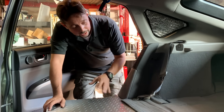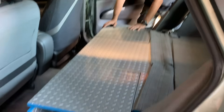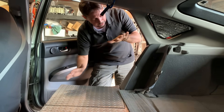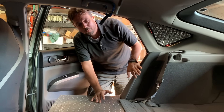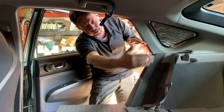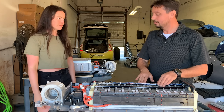So that little vent area in the back of your car, near the shoulder behind the passenger seat — normally there are seats back there and I see people traveling who just stuff everything in there. Now if you put anything there and this vent is closed, your battery is getting hot, and when it gets hot it will break. That air gets sucked through and affects the battery right down here. Make sure you have at least a foot of space around there so that cool air can get in and cool down your battery. Always keep that area clear.